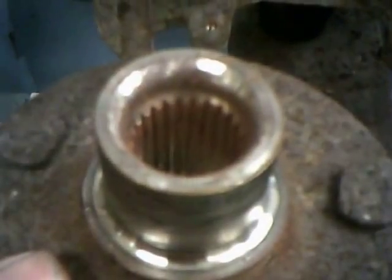Okay, we're pressing the bearing in, only pushing on the outside edge. I've got my chamfered bearing. It'll come down nice and straight. Okay, just stop moving. You want to stop right there. Then I'm going to knock that other bearing off.